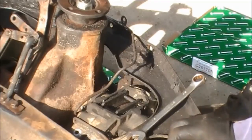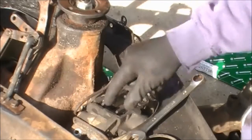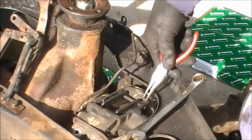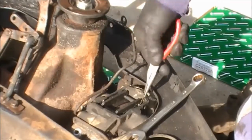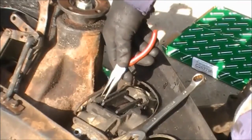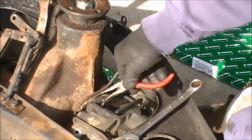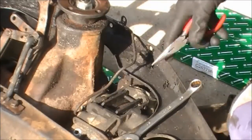The manual also suggests that when you pull this caliper out of the cage you've got to get it off that disc, and it's tight on that disc at the moment because of the pads. So what you should do is remove the pads. I've been spraying all this with easing oil, trying to make it easy.